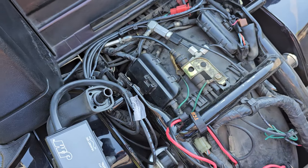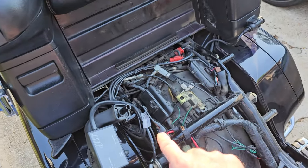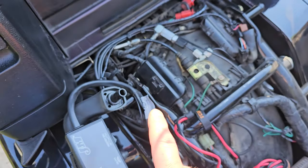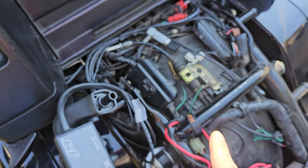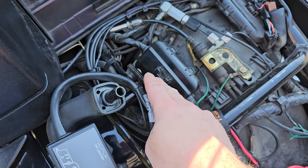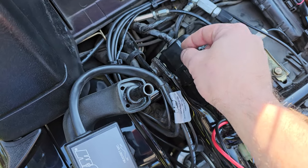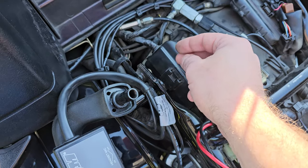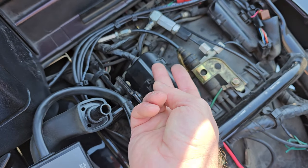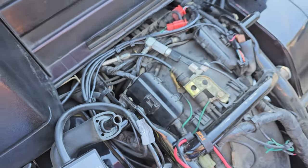This is the C33 plug if you look on a diagram. Once you get it apart, you want to look at pins three and four. The color of the wires on those pins are the red and white wire and the green and orange wire. What you're going to do is remove those wires out of the connector - get a little pick, put it in the holes on the front bottom, release the pressure off the little metal connectors, and it releases. Then pull those wires out and swap the positions of pins three and four.